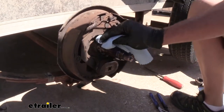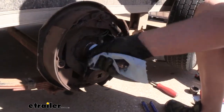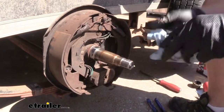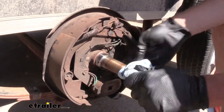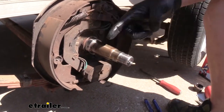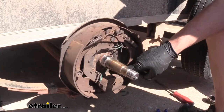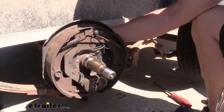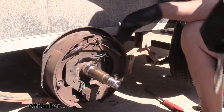Once that's off, we're going to clean everything up really well. We need to inspect our spindle here — we're going to be looking for any type of damage, any signs of major heat, or discoloration on it. Our seal rides right on this lip, so we want to make sure that's nice and clean and free of defect. We've got our inner bearing that goes here and our outer bearing that goes here, so we just want to make sure everything's nice and smooth with no cracking or discoloration. This one looks really good. For our brake assembly, we've got studs here — generally four or five — so we're going to back those nuts off on the back side and hang on to them so we can use them with our new brake assembly.